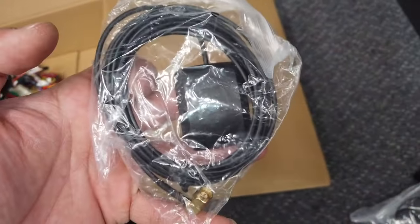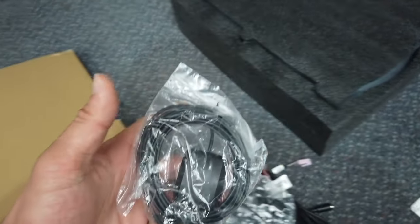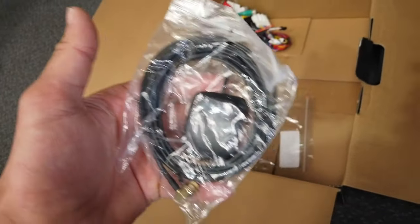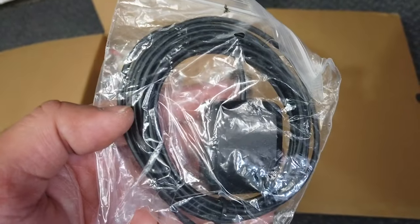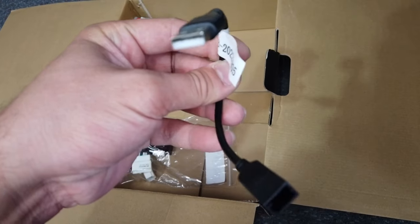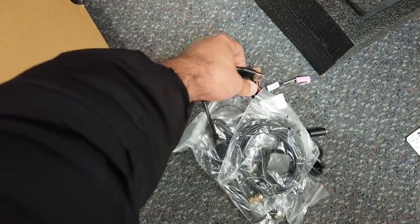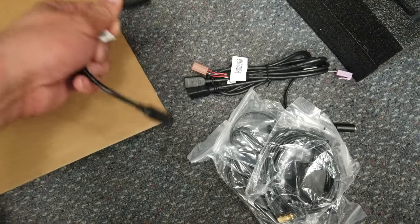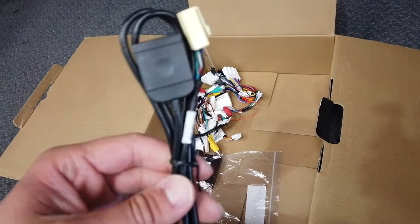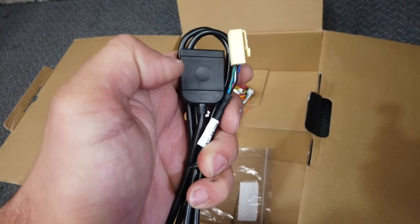The GPS is optional. It's used for navigation on the Tesla unit directly and not the navigation inside Apple CarPlay or Android Auto — those will use the GPS of your phone, not the GPS here. Then we have the factory retainer for the USB port. This is only for the 370Z models with a factory USB port in the armrest. You'll need to connect this to the USB inputs of the Tesla unit and then to the factory USB port behind the head unit on the 370Z. This is a SIM card slot — you can connect this to the Tesla unit and put in a SIM card to always have internet to the Tesla unit.